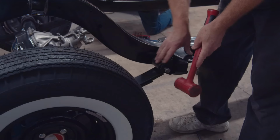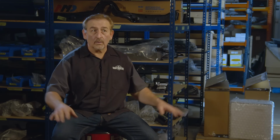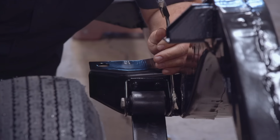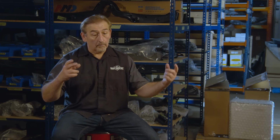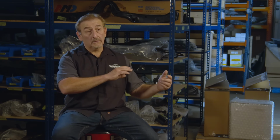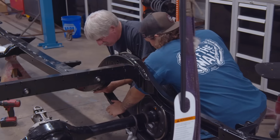So the nice thing about Christine is it uses a leaf spring rear suspension, torsion bar front suspension, just like the cars we work on today. I was able to use a Mopar rear shackle, brand new ones that we stock that we put on the muscle cars. I ordered a pair of replica, original, duplicate leaf springs, and then the original hangers, all we had to do was take them off, media blast them, paint them, and get ready to put it back on. So our bushings and our inserts and things like that, we were able to use the stuff off of today's car on that car. So there's some interchangeability there, which I think is kind of cool for that many years. Another, 10 years prior to the stuff we're working on, they were using the same stuff.